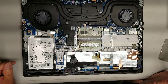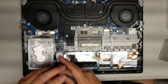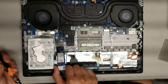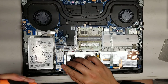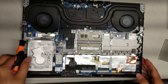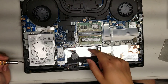So that's pretty much all there is to this computer. Hopefully this video helped you — if it did, please like and subscribe. Actually, let me show you one more thing: I believe there's the keyboard backlight cable under here. There's the keyboard connector here, but I don't see a keyboard backlight connector anywhere. So if you're going to take out the motherboard or logic board, just be careful lifting it up because there's a good chance the keyboard backlight connector is underneath there. I don't see it connected anywhere on the board, so just be careful lifting out the board — it's most likely connected underneath, so if you yank on it, it's probably going to rip the cable.